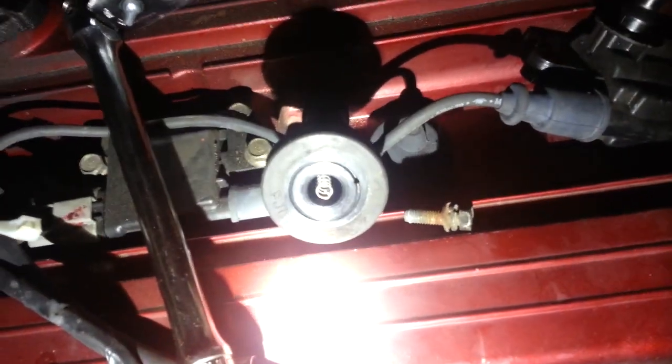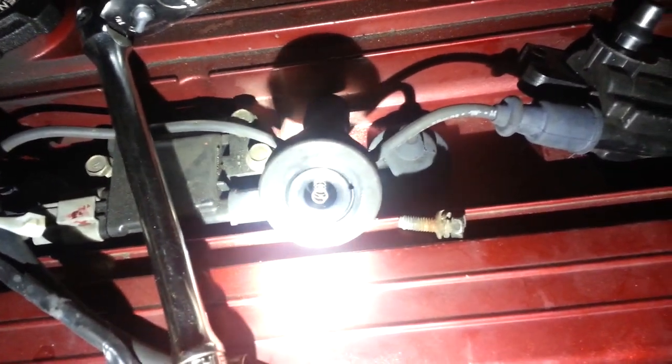That spring in the bottom of the coil-on-plug will get corrosion and stuff like that. You'll start to see current leakage and current arcing off of these points here.